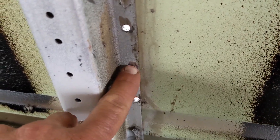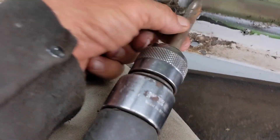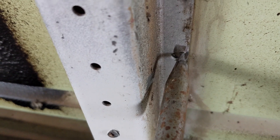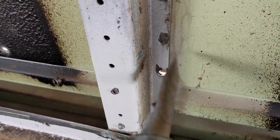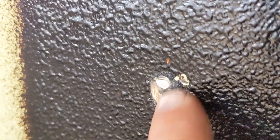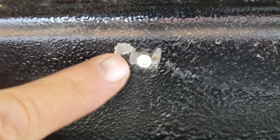For punching the body and head of the rivet out, I use an air chisel with a pointed tip. When you do it, put the point up against the rivet and push on it so you're not bouncing around — if you hold it out too far it's hard to control. Sometimes you'll bounce off the rivet and that's okay. I dented the metal a little bit in a couple of spots, but it's not a big deal — up here it'll be behind the lower part of the rub rail, and the portion down here is getting cut out anyway. Put the chisel tip right up on the rivet, apply some pressure, and push it out.